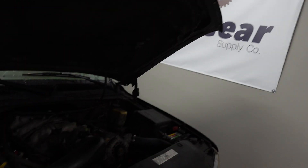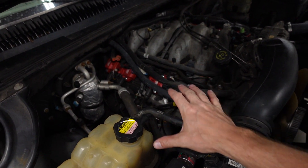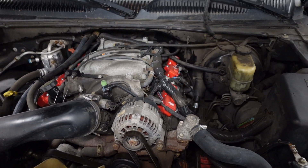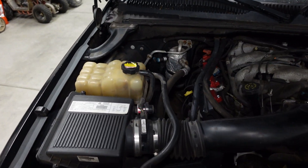To get there, obviously I need a whole lot more air and fuel going through the engine. My preferred method, the route I'm going to take this time around, is going to be turbocharging. I want to run a single turbo in the same way that a lot of LS guys do on a truck like this, mounted right up near the front of the passenger side cylinder head. I'll use the stock manifold on the driver side and route the exhaust gas down below the oil pan and back up where it will all merge together.